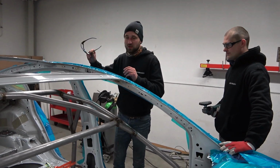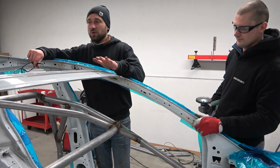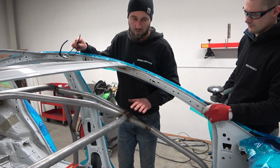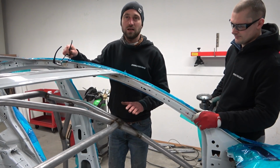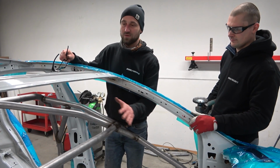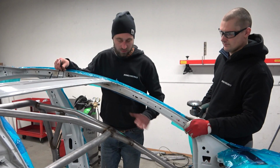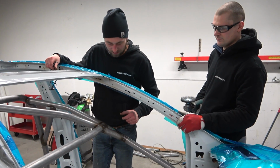First of all, I want to say, when you build a roll cage, after you finish one welding step, for example all the top of the roll cage in the car, like this, while you have reachable points, I suggest always cleaning the welding spots. Why? Because if you don't clean it, after 2 days it will get all rusty, brown and ugly, and later when the roll cage is in place, you cannot reach this place to clean. So when you clean everything now, later after priming and painting you just need to go over the whole roll cage with Scotch-Brite and brake cleaner, and you can paint it. You save a lot of time, nerves and everything.